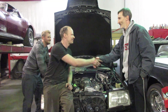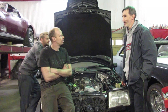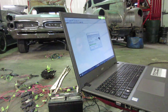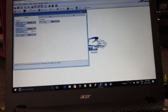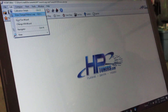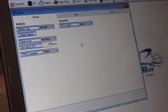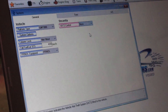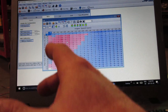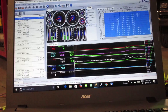I got my buddy Chris here, who's actually a friend of Todd's. Basically just take us quickly through it — what do you do? So basically we use HP Tuner software. You can use it to tune, you can use it to scan. The HP Tuner is about as user-friendly as it possibly gets. You can get it off eBay or even off Summit. You get the HP Tuner interface and along with that you get credits, and a certain amount of credits unlock certain features of the computer — we use up two of those credits. Once you get access to that computer, basically the sky's the limit. For now, we're going to unlock the VATS system — the vehicle anti-theft system — and that will allow us to run the engine on the stand and make sure that it runs. And then with a subscription to the HP Tuner website, you can download somebody else's tune on an engine that is similar, and then fine-tune it from there, skipping literally 10 hours of tuning.